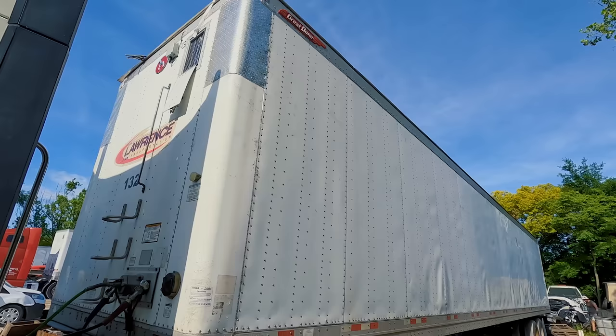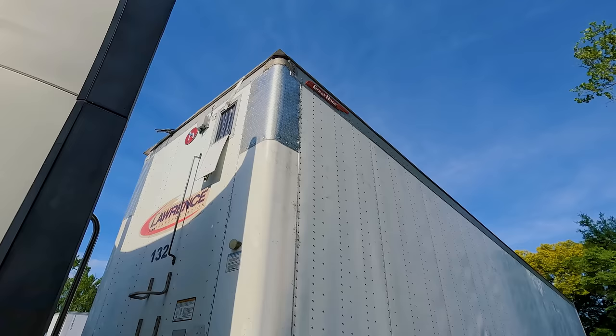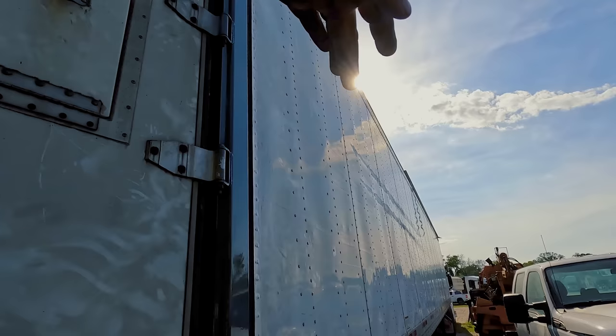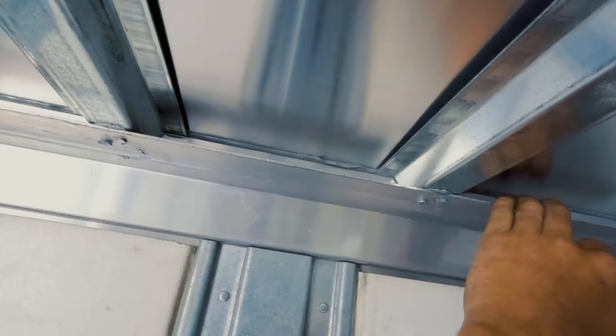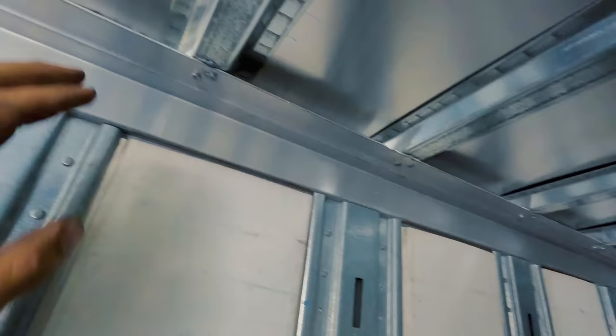Oh man, I am tired and hot - this sun is just killing me. But we actually need the sun: the aluminum sheeting needs to heat up a lot before you start stapling it down, but it's still slightly wavy from the top when you look at it. We got this whole side done and about half of the passenger side done. We have to trim this side a little bit. Inside looks really, really good. Here's our caulking tape - you can see it's slightly sticking out all around the perimeter. It's gonna seal really well.